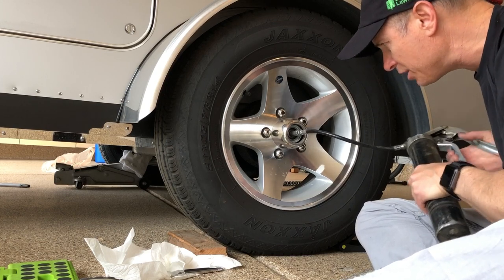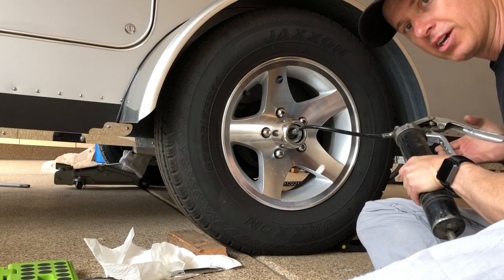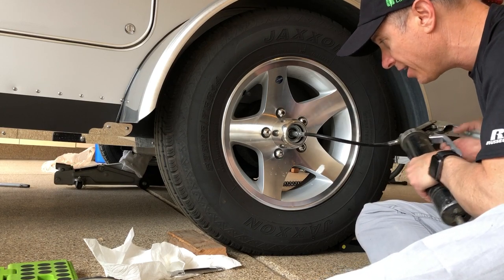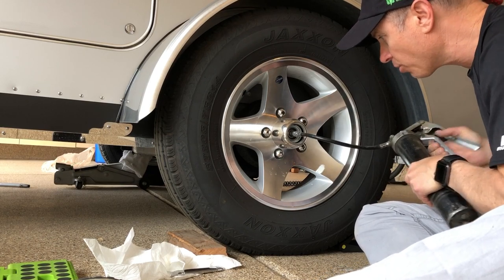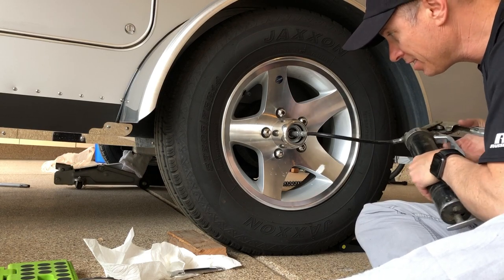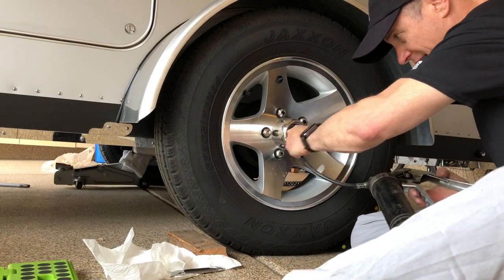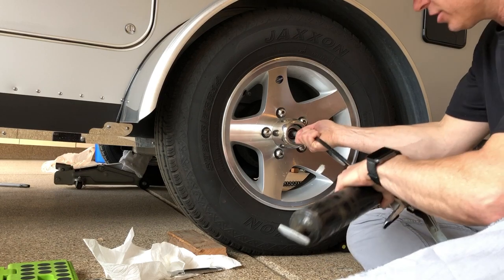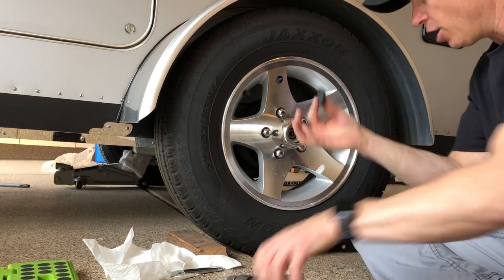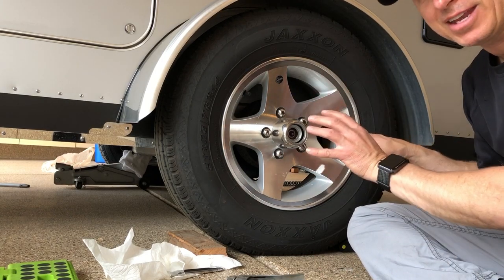Just like the other side, I had to put a lot of grease in there for it to start squirting out of the sides, but you know it's full when it starts squirting out. So just keep squirting away — it'll show you when it's full. Looks like it's full there. I'll clean this up, put the cap back on, and this side is done. You can see how much faster that is.